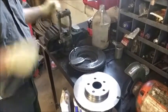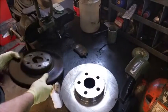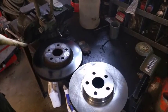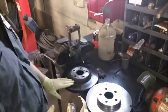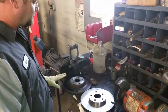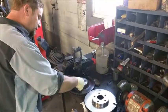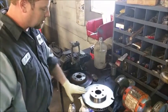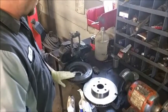If you want to take a look at the rotors — now many people ask, can I just do my brake pads? I just want a pad slap. I don't want to pay for rotors. Why do I need rotors? Well, there are lots of reasons. Any time you do a brake job, to appropriately do it, the rotor needs to be addressed. There are two ways of going about doing that: one is you can machine the rotors. The rotor spins and a steel blade comes and does a very light cut, making it look pretty much like new. Now on this rotor, on the back side, that would not work.